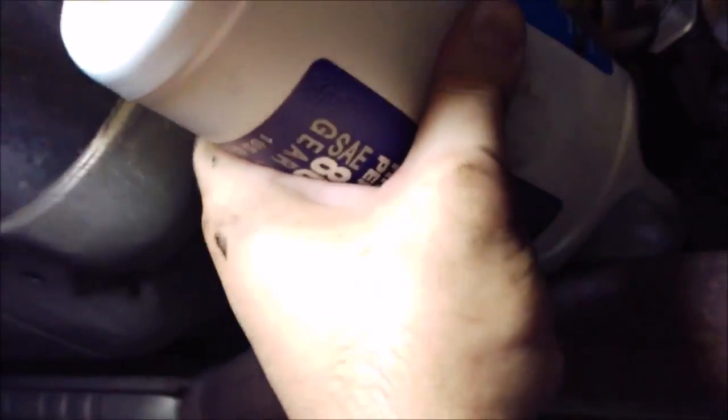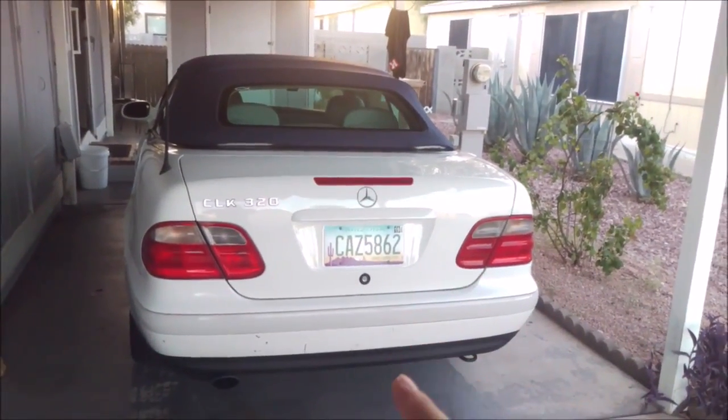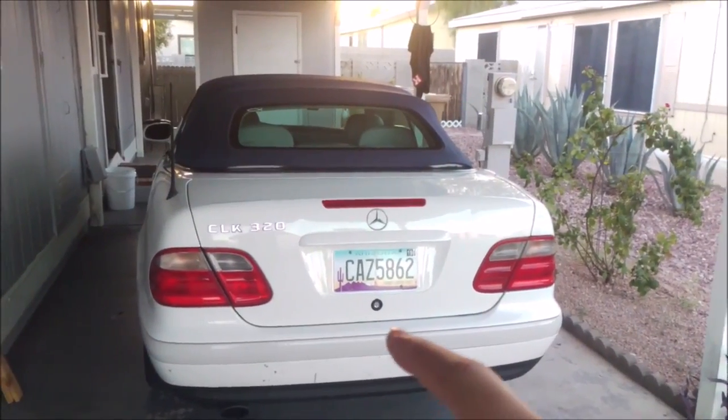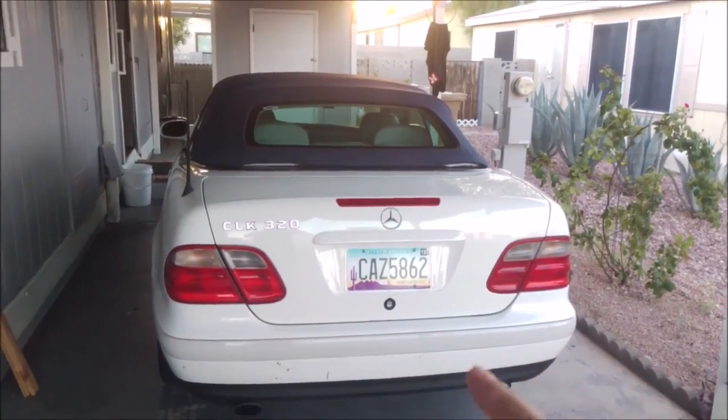It's working because this diff takes 1.1 liters. I have 2 liters. I just swap the caps, the lids, and then I can just keep continuing to do this until the fluid comes out of the fill bolt. Okay, so just keep doing that until the fluid comes out of the fill bolt. Alright guys, so that was it for the diff fluid change. After you're done filling and the fluid starts coming out of the filler plug, you just snug it tight.